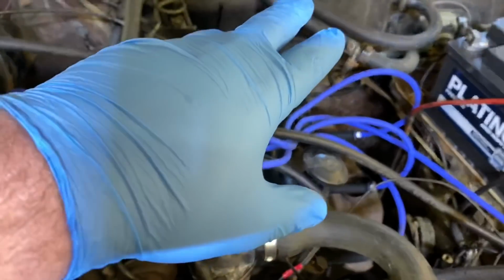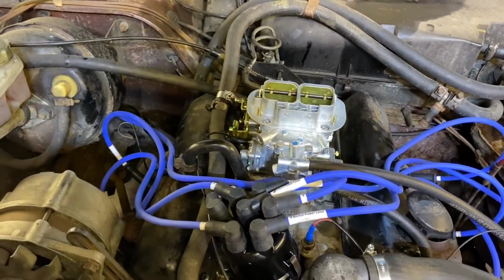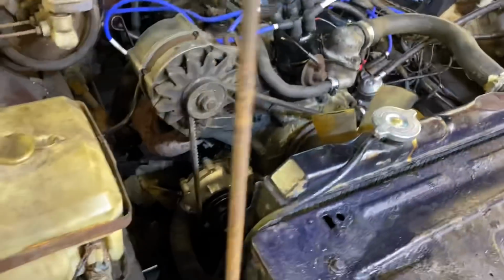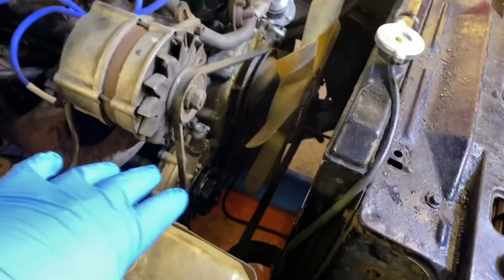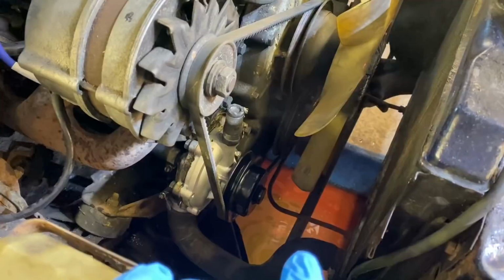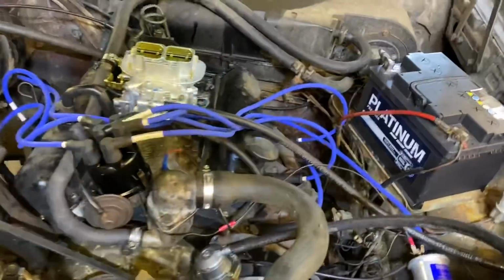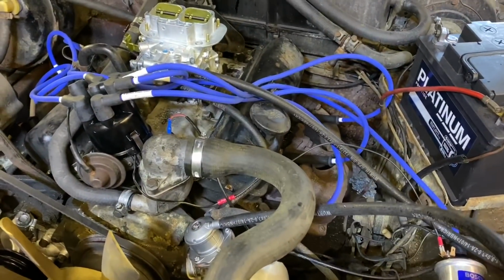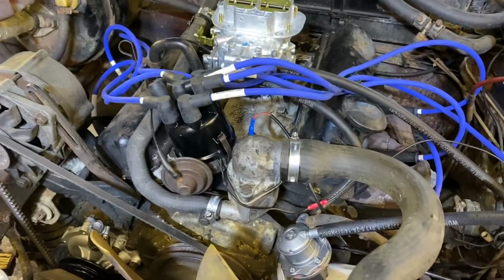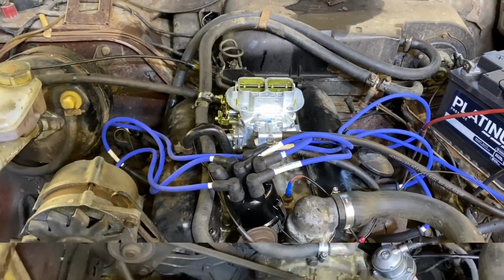They can't get the heating working just yet. They're going to have a fiddle. They're going to have to replace some fuel lines and clean some. There was no power steering fluid in the rack, so they've topped it all up, and now it's leaking from the rack. So need to have a look at that. It's probably going to need reconditioning by the look of it, but so far so good. Let me go and start it up and show you her running.